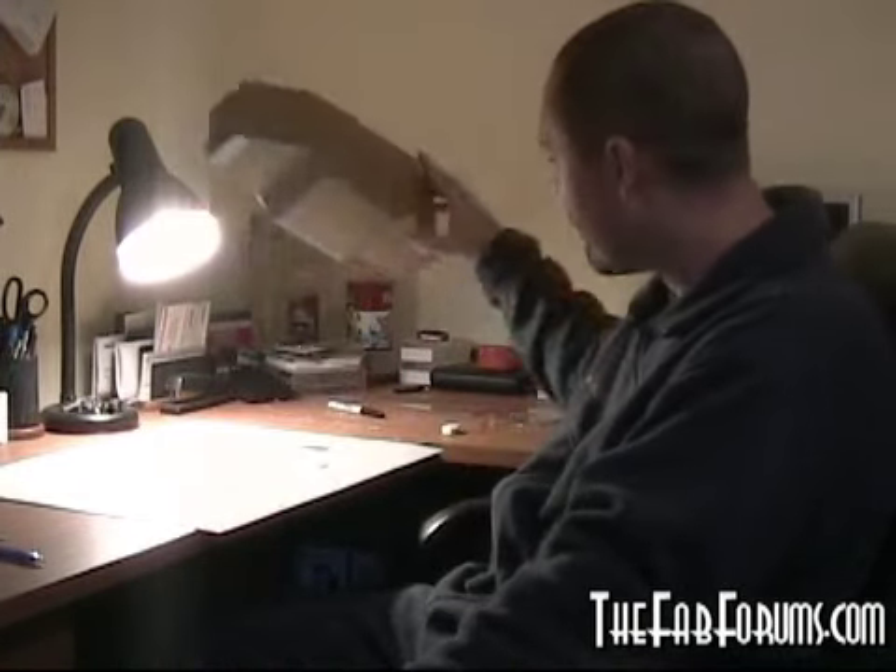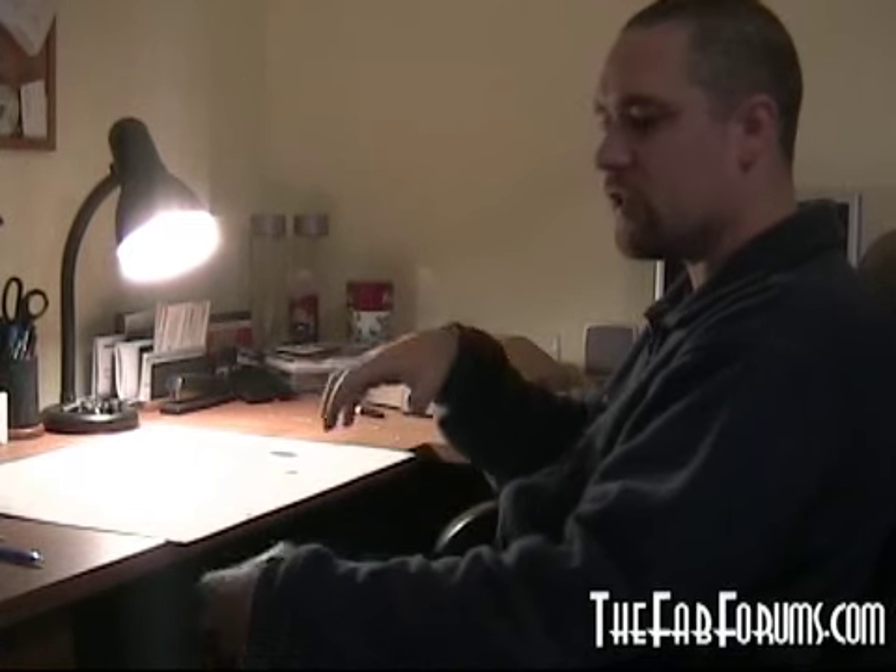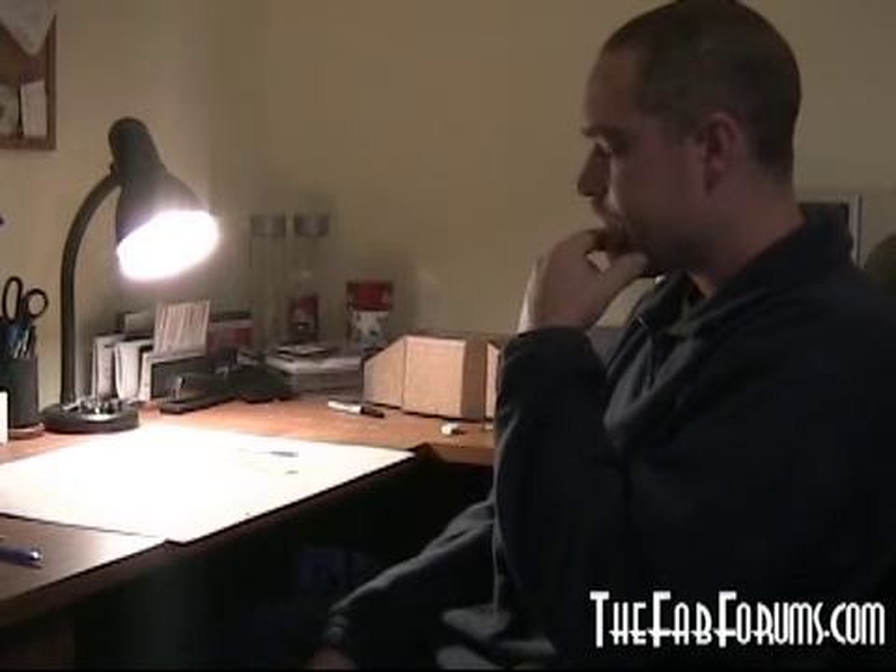It may be one of those deals where I'll do what I know, cut it out, fold it up, and see what we've got left to make it happen. Every good design starts on paper — this will minimize the amount of effort once we get it to the metal stage. I like to draw it out, cut it, fold it up, tape it, and then stick it on the intake. Make sure all your clearances are right, make sure the bolt holes are going to be accessible, the throttle body blade lever is going to clear. This particular one we're going to have a little bit of trouble with the distributor clearance, so that's something we're going to have to look at.